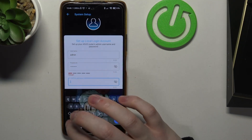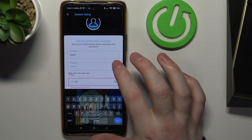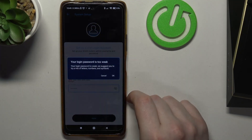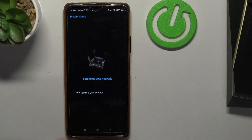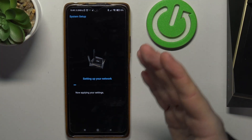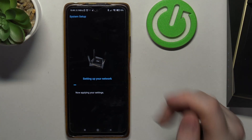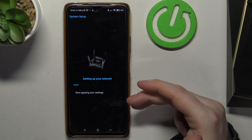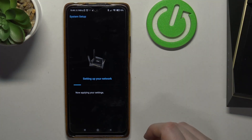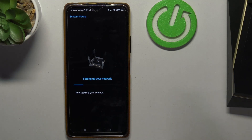Let it be like that and then we need to confirm it and click Apply. Now it's going to apply the settings. The thing I mentioned about disconnecting other Wi-Fi connections is that when you're setting it up, it will reconnect to that router multiple times and might accidentally connect to another router, which will basically break the entire setup. So be sure to disconnect any other network when trying this setup.